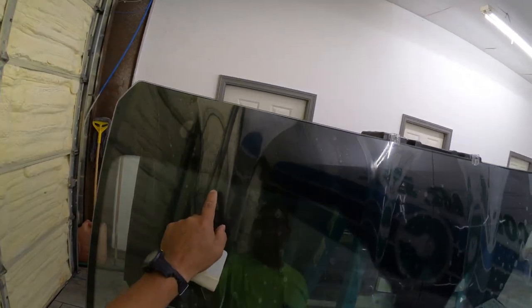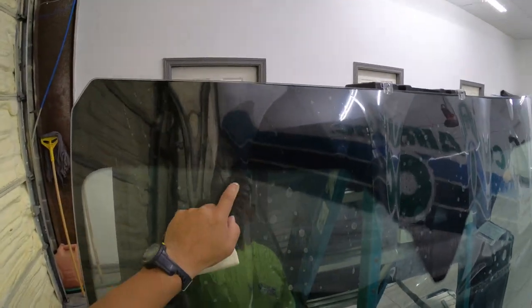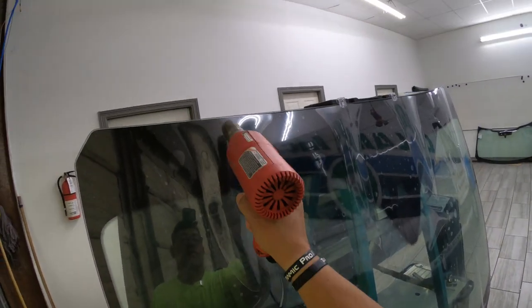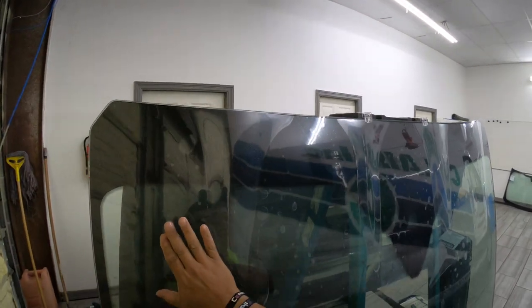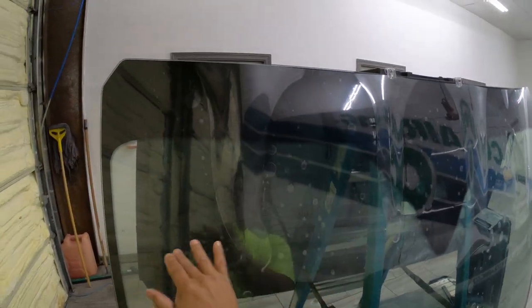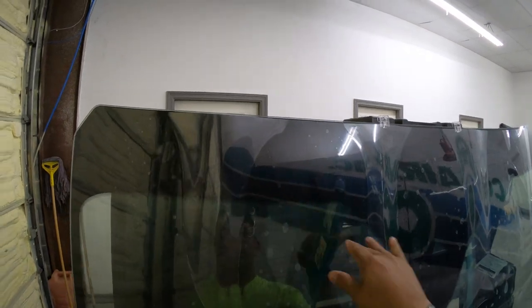When we are shrinking this finger, it is very huge. This is not regular car window tinting — this is security film, kind of an exterior windshield protection film by UltraFit. When shrinking, we're not attacking just the little finger or big finger because this is a very small area. We're going to be using all the area for shrinking, because all this is going to mold and conform into this area. I'm going to shrink section by section from here to here, and as I see the film is affected, I'm going to start distributing it.